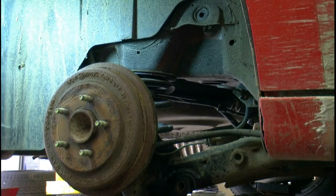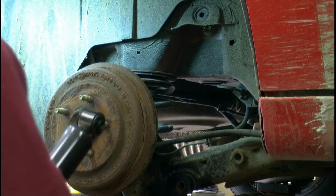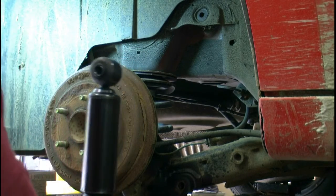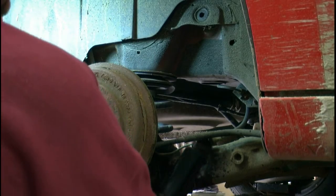Back to the install on the rear shocks of this 2008 HHR. The upper bolt came out really nice; the lower bottom bolt, not so nice — I had to torch it out of its sleeve. It took a little longer than normal, but it doesn't surprise me. Anyway, new shocks going in.